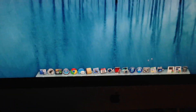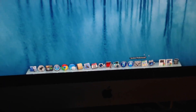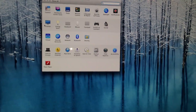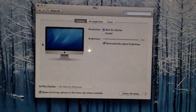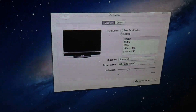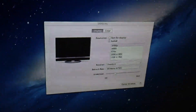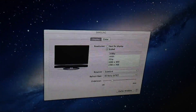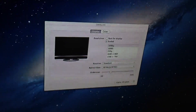If your picture is not fitting on your TV, go down to System Preferences, then go up to Displays. A box will come up on your Mac and another box will come up on your TV showing your TV model — it might say Samsung, for example. It'll give you the resolution and a color option. Make sure the refresh rate is on the highest, then click through the resolutions and pick which one is best for your TV, or select 'Best for Display' and it'll do it automatically.